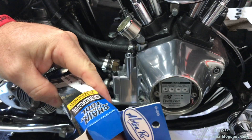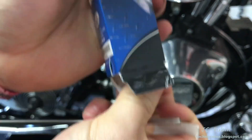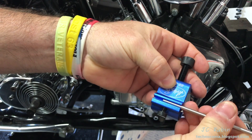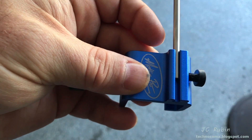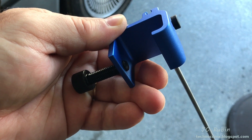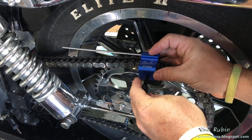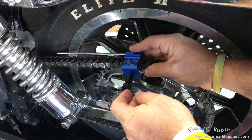The unit comes in the box in two pieces: one side is the metal rod — make sure you don't bend it, even check it on a glass mirror to make sure it's flat. The other half appears to be anodized aluminum. The set screw is opened up, the rod is inserted past the set screw in whatever direction is appropriate depending on which side your chain is on, and then the set screw is snugged down. As we rotate the piece, the flat side holds onto the inside of the sprocket, and the outer set screw is on the left-hand side.